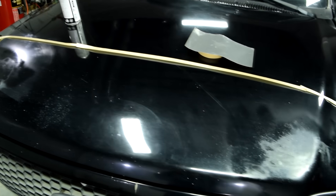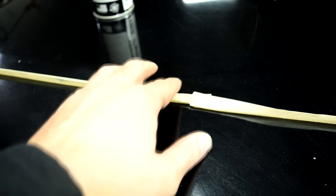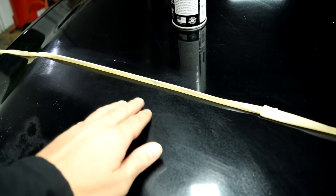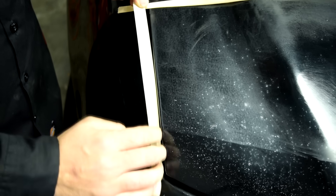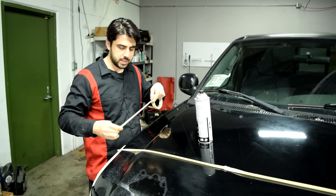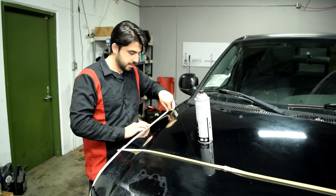Here's a look at the boundary we have so far. If you peel back the tape like this, it helps ensure your sanding block does not accidentally go over it. When you're sanding, try to stop short about an inch before you get to the boundary line. It's very important to also tape the edges of the adjacent panels so you don't accidentally scratch them. You want to do this all the way to the top on both sides because you'll eventually need to sand down the entire panel.